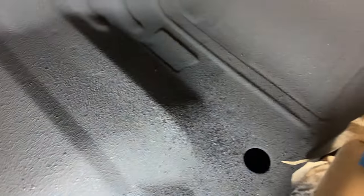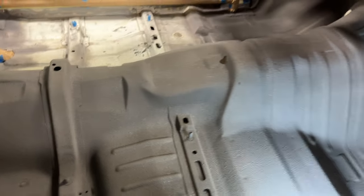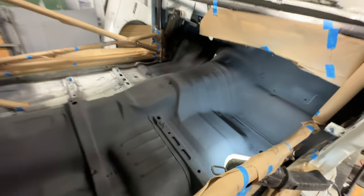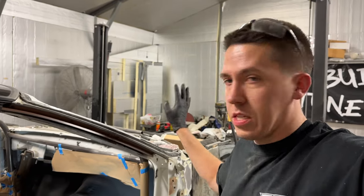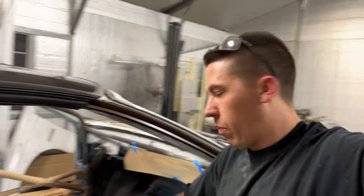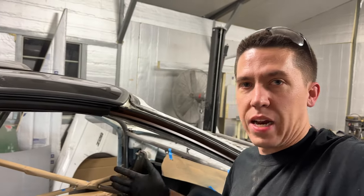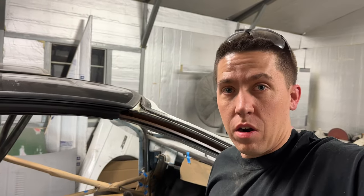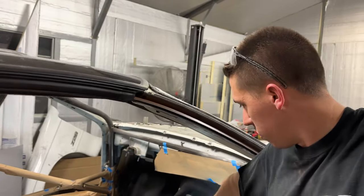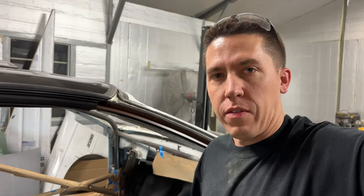Mid-spray update: there are only a few spots that actually look wet. The rest looks pretty dry as it's going down. Looking on the mil gauge, I'm pretty thin, but really where I want it thick is on the firewall — I checked it and I was close. Through the floor I'm pretty thin, but under the seat and stuff like that, it's not as big a deal — not as much heat through there. I might be able to coat most of the floor a lot thinner because I'm not looking for heat properties other than around the transmission and firewall. You do have a little heat coming off the road on these drag drives, so some coating there will help, but it's not nearly as important as where the hot stuff is.